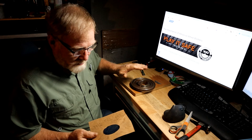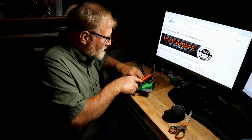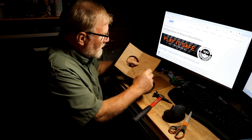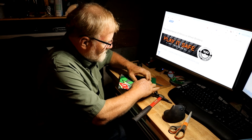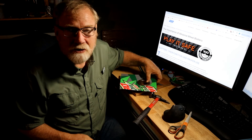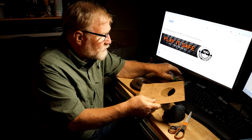That was kind of what I thought would work, except I don't drink beer from cans anymore — I use Mountain Dew. So I got my Mountain Dew carton, flattened it out, and started making a blotter. I took a piece of paper and used an old Mayhew-type hammer to go around the edge of the boss, which imprinted a line I could cut with a razor blade. I cut that out, then put it on my wheel and traced around the outside of the flange — just like making a gasket for an engine. I cut it out with my razor blade and ended up with a blotter.